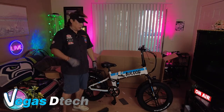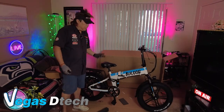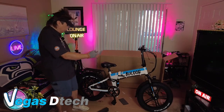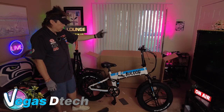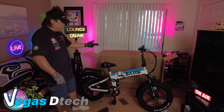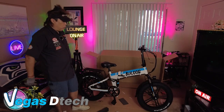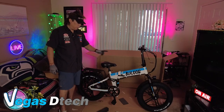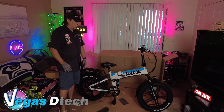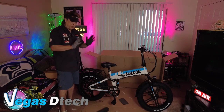The thin spacer is gonna be on the rotor side. The wide spacer will be on the opposite. You'll need to attach your headlight, your front fender, and that's it, guys. Just put in the handlebar onto the neck. Battery is about 25% charged. I'm gonna go ahead and run through and do a quality check on this bike, which will consist of checking the front axles, making sure they're torqued down correctly, checking the clearances on the brakes, make sure they're not rubbing.